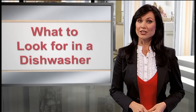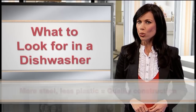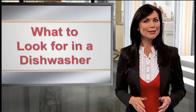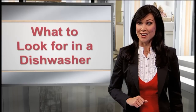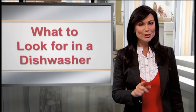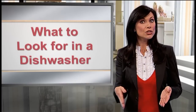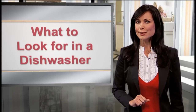Quality and fit and feel is number one. You want features that withstand time and use. More stainless steel and less plastic mean components that will endure. A look at the shipping weight of products is a good clue to what a dishwasher is really made of. ASCO uses a premium grade of quality stainless steel for the interior, which has a higher percentage of nickel, which protects against corrosion. Try the magnet test — if a magnet sticks to the interior of your stainless steel dishwasher, it indicates a lower quality stainless steel was used.